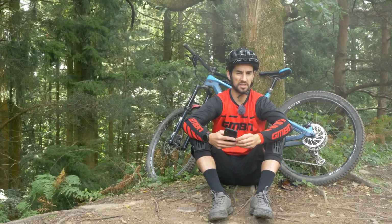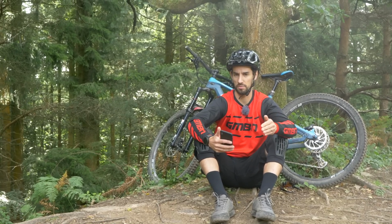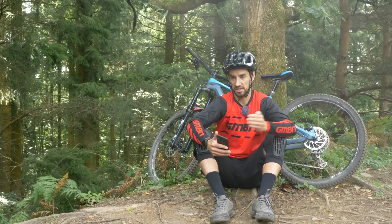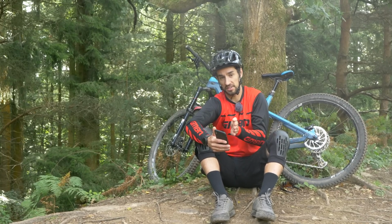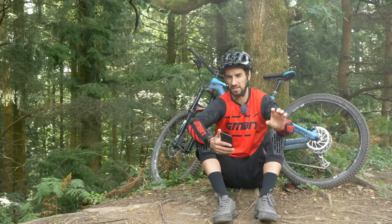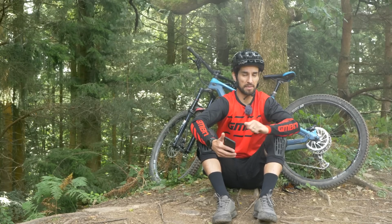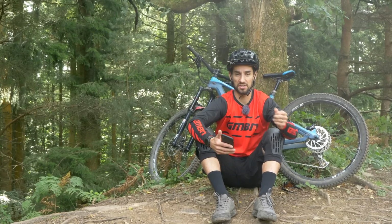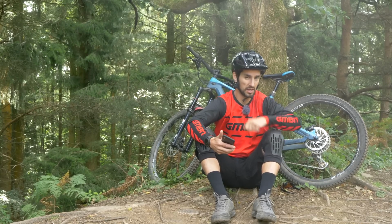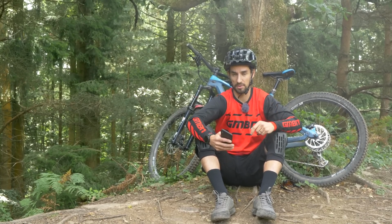My first thing I check would be the cable. Sometimes if they're getting old and getting lots of friction, then it just won't want to drop down to that very lowest gear. Well, the very highest gear, I should say, but the one right next to the chainstay, just because the sort of spring tension of the mech, it always seems to almost reduce the further down the block it gets. So check the cable's not old, and the best way of checking that is just undo the cable from the rear mech. And if you've got it in the bike stand, so the cable's completely loose, spin the pedals, does it now go down to the bottom gear, then that's definitely your cable.